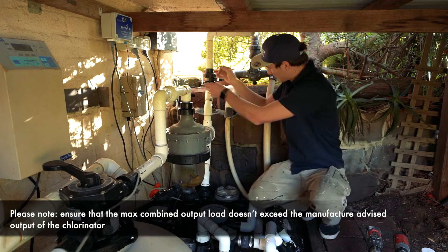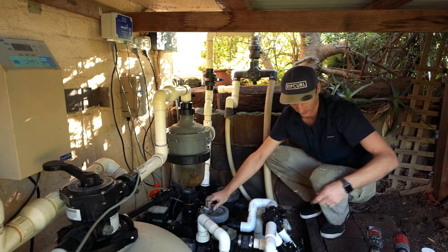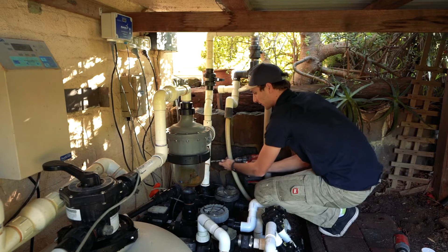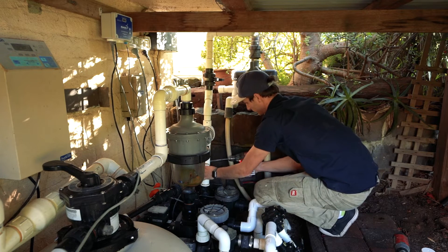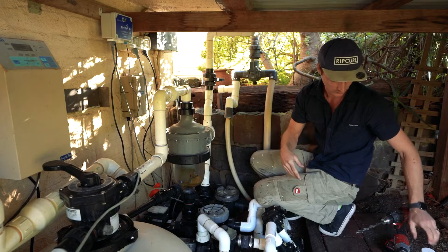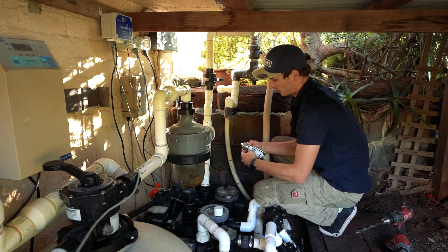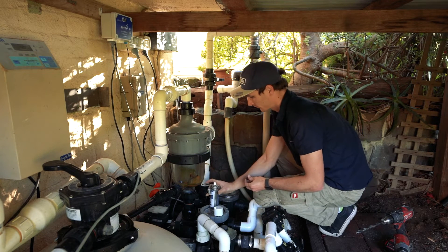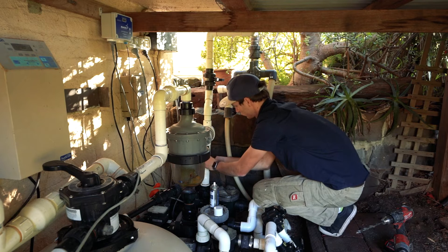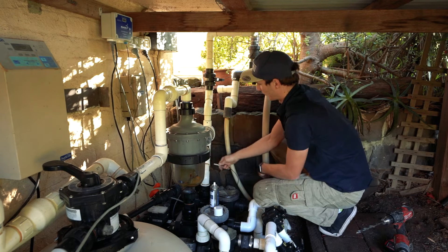Keep the wire a little bit neat and work out a location for where you want to install the sensor. I'm going to drill through here with a 14mm drill bit, running it in reverse. Clean out any swarf, then lubricate the hole. Remove the grommet, lubricate the grommet, push it in, and then push the sensor into place.